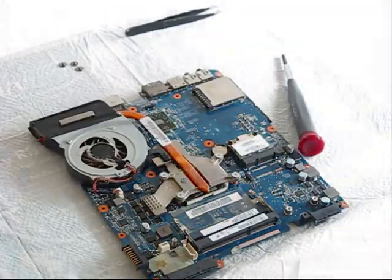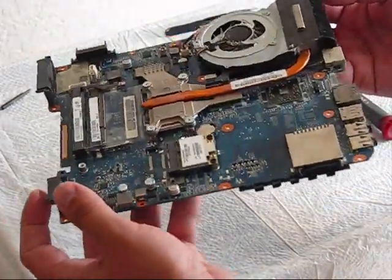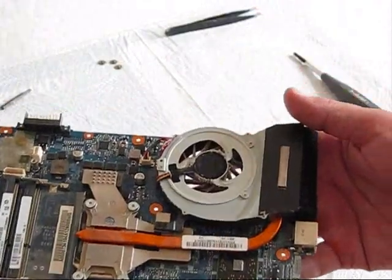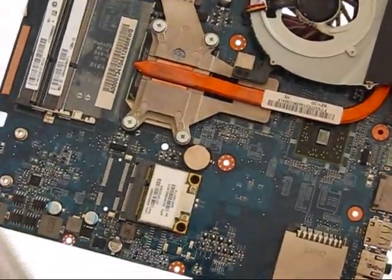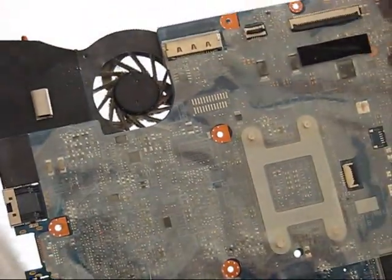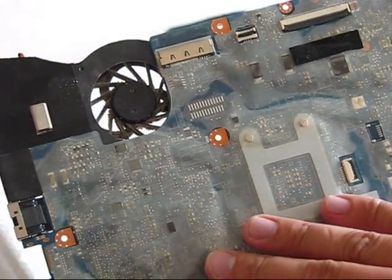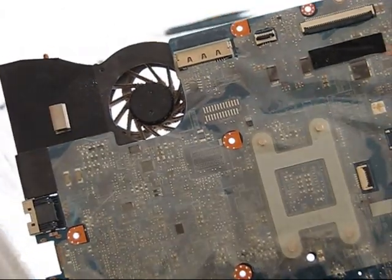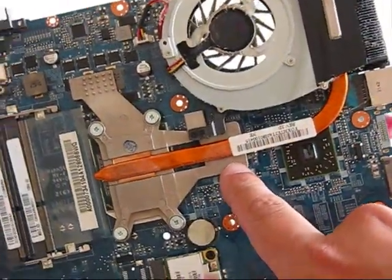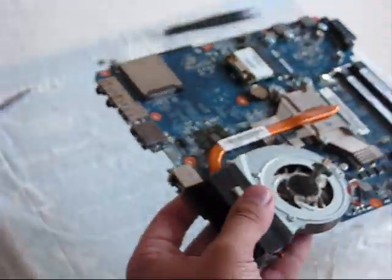Set it temporarily aside — you don't need to deep clean it yet. On the motherboard itself, especially in the cooling fan and heat sinks, we see some dust, but not that much — just a light amount. We cannot say this motherboard is very dusty. The protective tape on the other side needs to be removed as well since there is dust under it. Maybe this is causing the video to be gone. I believe the GPU, located right here, needs to get a reflow since the video is gone. That's why you need to remove the heat sink.